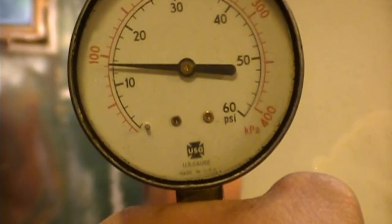I'm going to let it run a little longer to get that oil light to come on. If the light comes on while pressure is still up, that tells me it's the sending unit. I'll prop the gauge up on the glass and hold it there with a cloth so I can watch both the gauge and the warning light at the same time. Let's see if we can get this light to come on.